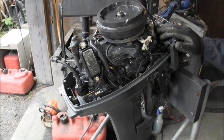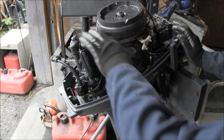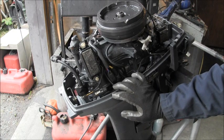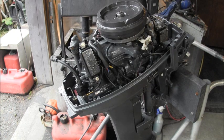So we got the carburetor back on, we got everything looking good, all the wires in pretty nice order. Got to get the recoil back on. The CDI and the coil are good. I do believe that tang breaking off on this motor was probably almost its death — at least its death for a decade and a half, if not more. So we've got good compression, we've got good spark. I need to get the recoil back on and then I got to look at this tiller real quick and see how that's going to pan out.